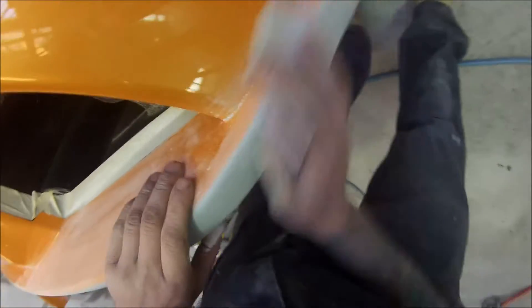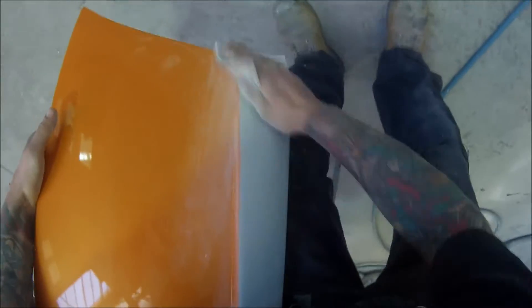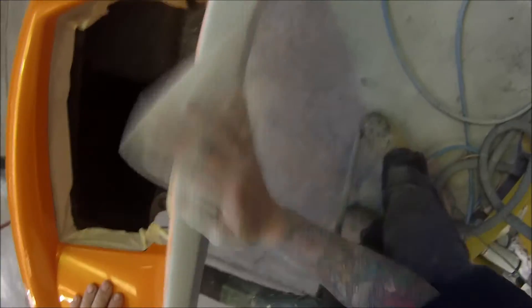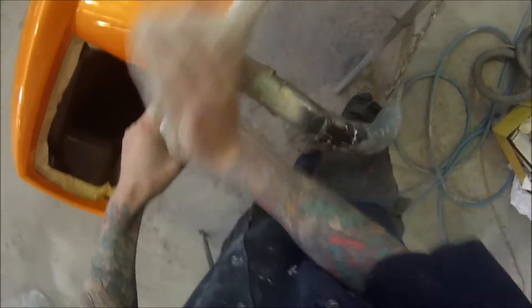Some people would look at this and say, 'oh, it's such a nice car, you should wet rub it.' But I'm so confident in dry rubbing that I've got more confidence in dry sanding than wet sanding. Sometimes the boss comes down and tells me to wet sand on a really nice car, but I tell him whatever he wants and then go back to my dry sanding — he comes from the old school and I'm from the new school. Dry sanding does work if you do it properly. You just have to be quite clean: whenever you finish one stage, you clean it off, blow it down, wipe it down. If you do it properly it's a lot quicker and actually cleaner too.